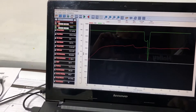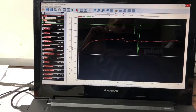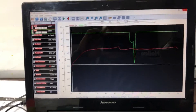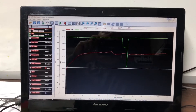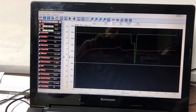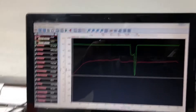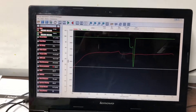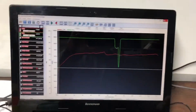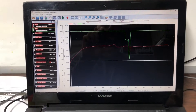The topic we're going to be discussing is converter slippage and noticing when it's really becoming a problem. You can run numbers all day, but up until about five or six percent slip it's not really causing a problem. When you get around ten percent it's really starting to hurt - if you're making a thousand horsepower you're losing a hundred of it through the converter, and a hundred horsepower at the level we race at is about a tenth to a tenth and a half.